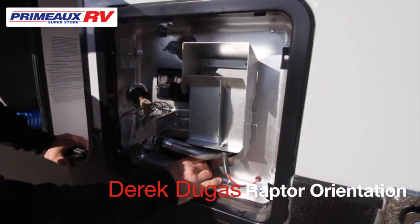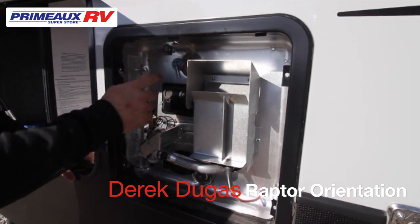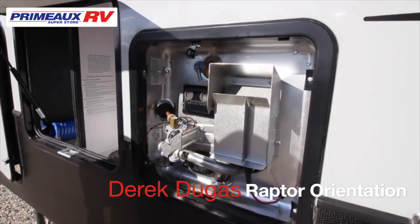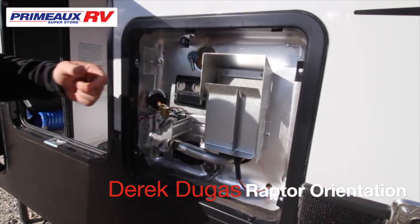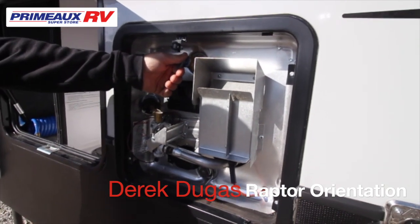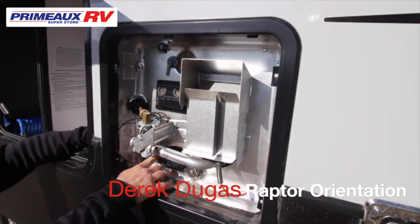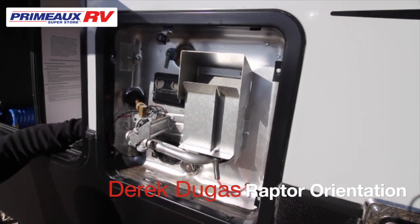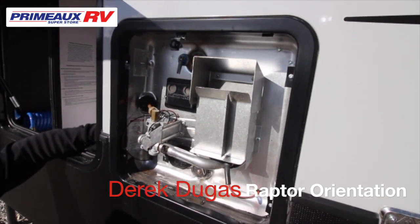So before you undo this anode, what you're gonna wanna do is release the pressure from this pressure valve. Then you pull your anode out, check it. If you need another one, go ahead, put it in. Then you're gonna hook up your water, let it flow, pull this until the water's coming out, and now you could turn it on again. But on the outside, this switch here also runs your electric side. So you can run the electric from the inside or the outside, and the gas is only on the inside, and I'll show you that once we get in.